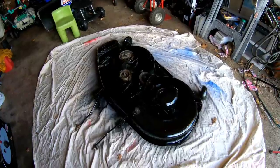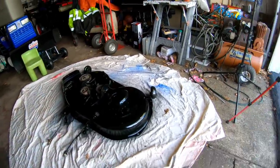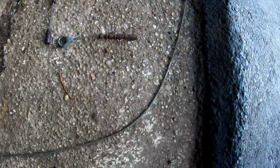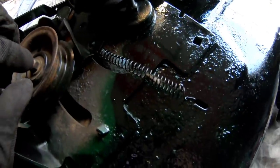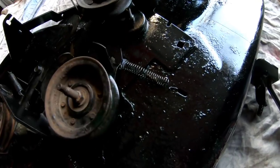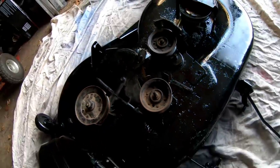All I'll need is one or maybe two more decks. You get there when you get there — I didn't go out and buy any, they just show up eventually. I also pulled out these parts from my shed. This is for the Snapper 1350 that I picked off the street — it's the Kohler 12.5 engine I took off it. I also found a spring for the return: when you engage the PTO it goes here and the spring pulls it back. It's not exactly the right spring but it works. As long as it gets that tension arm back into place, that's all you need. It should be a thicker gauge one, but if it works, why not? So I need to find a belt — I have lots of belts in the back shed.